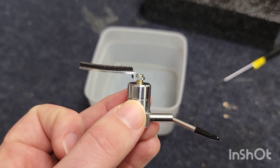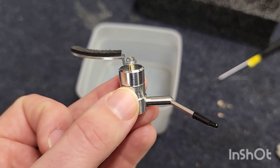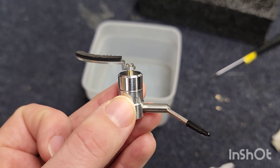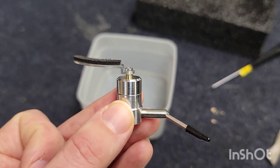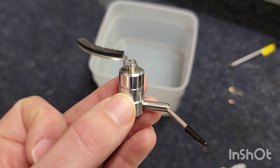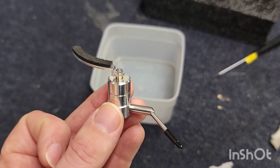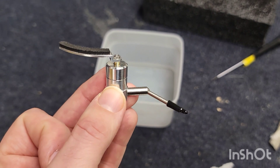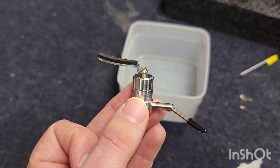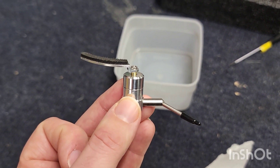Then we put the lube on the piston portion, which was the brass piece. You can take it off, put it on, do it any specific way — we go for a setting that will go down slowly but not super fast or slow. No single setting is correct; it's really just right for you as the user. If the arm lifter is broken, you can always get a new one right from VPI or a local dealer.